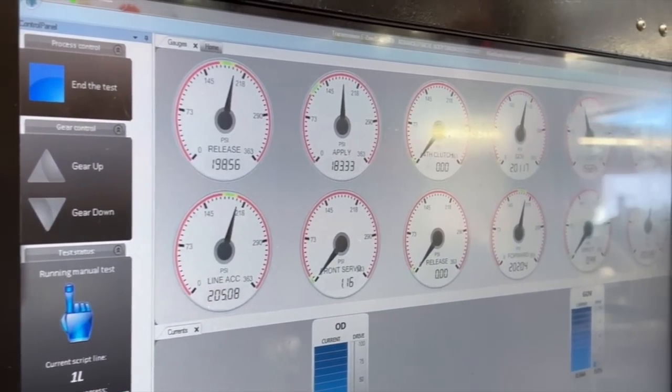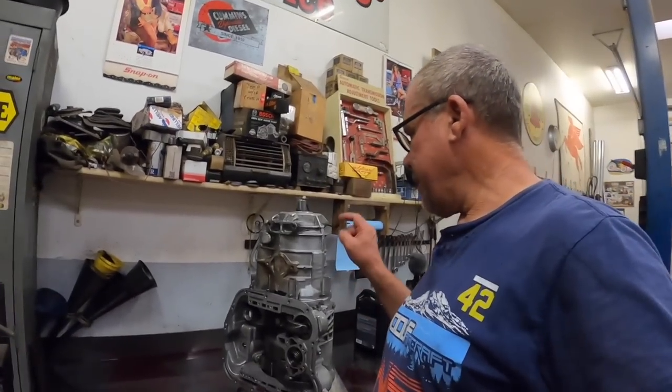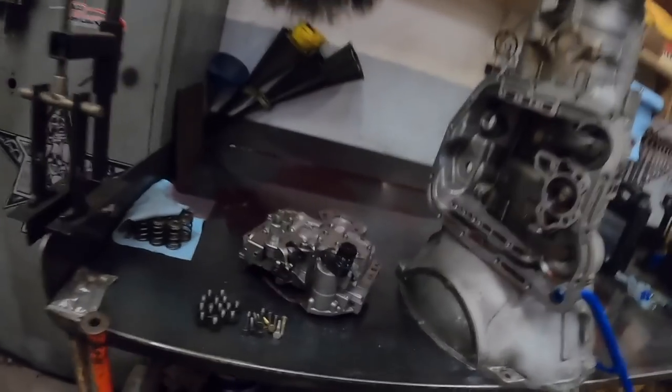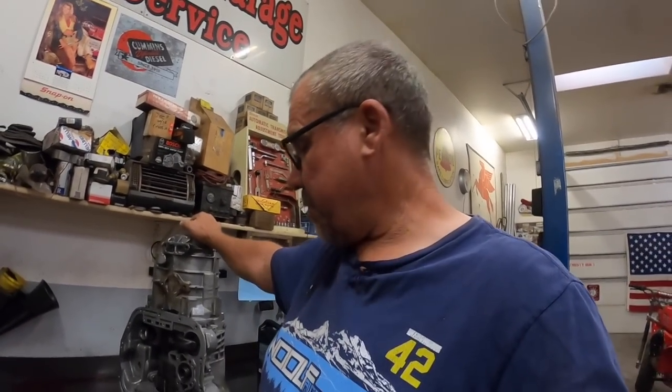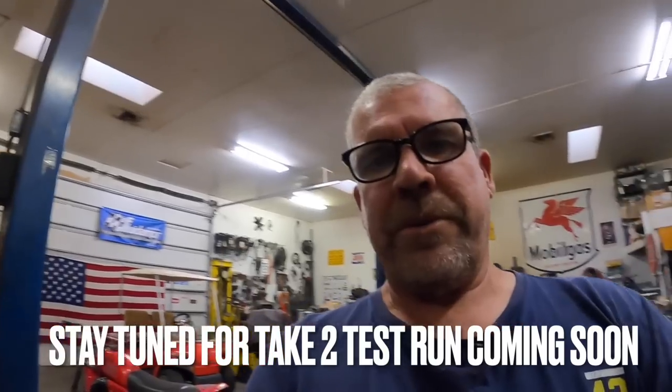There's no lockup on it now in second, and it's just going to drop back into first gear, where you'll have reverse servo and forward pressure on the forward clutch. You're pretty much good to run right there. Now, as long as everything else I did in the transmission is right. It's on me and Jimmy — I'm just the valve body builder. If anything goes wrong, it's all on the trans guy. Jimmy and I are back from our run to Phoenix. Got the transmission here. I air-tested it — never assume it's good, but I air-tested it and it's good. I got the valve body that Tier 1 helped me out with. Hopefully it'll work as good on this transmission as it worked on that dyno machine, because it looked good — pressures were good. We're going to get that installed, get it back in the boat, and go for a boat rip. Thanks for watching.